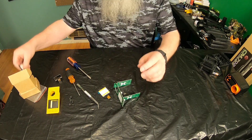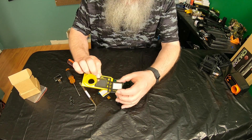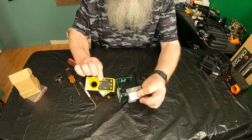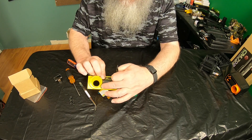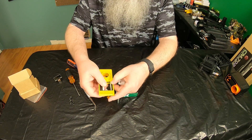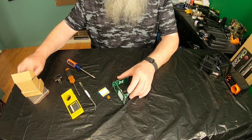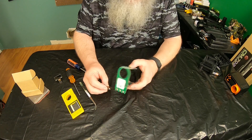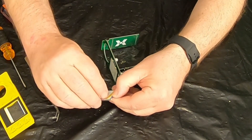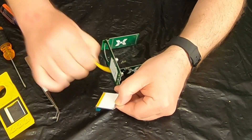Now, the company sent me a bezel that fits on the front here. My bezel wasn't damaged, so I'm not going to replace it, but it's held in place with two adhesive strips here and here — you can see it on the back. All you have to do is turn it over and push it out if you want. Now, to install your LCD, there are two adhesive strips right here. Go ahead and pull the little protective piece off.